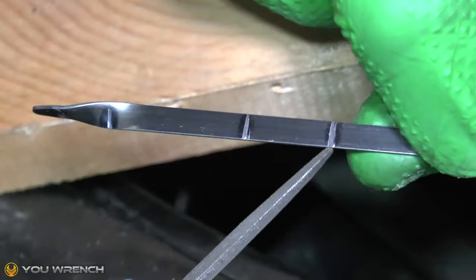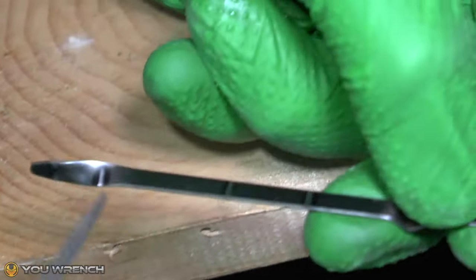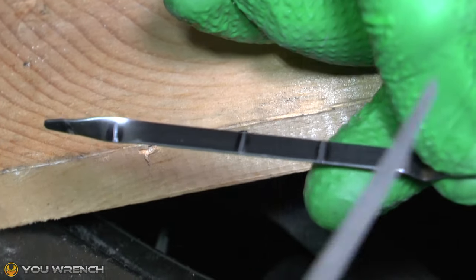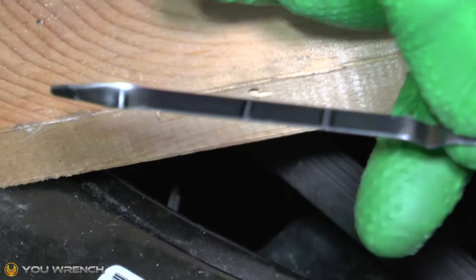As you can see, we've just scratched that in gently with a file there and they've come out quite well. We're going to give this another quick wipe over — obviously we don't want to put any metal filings into the port when we put this down. So make sure you give it a good clean now that you've done your filing.